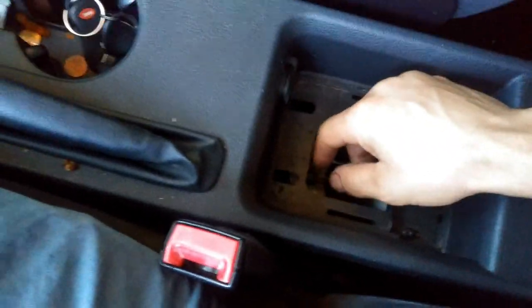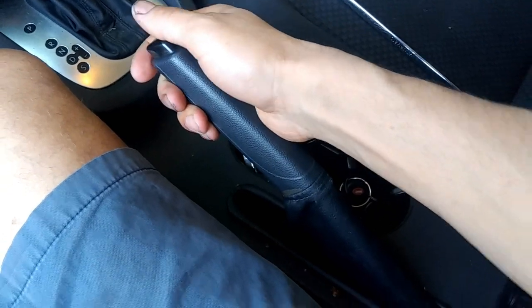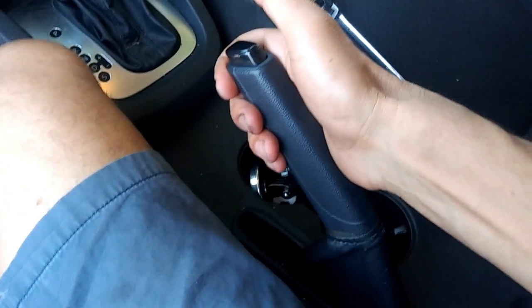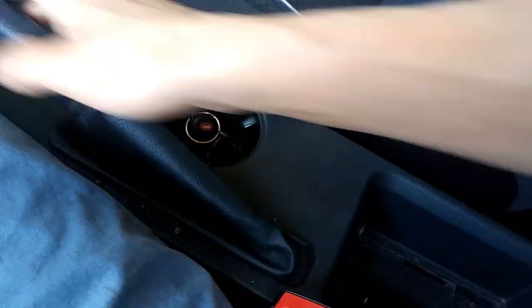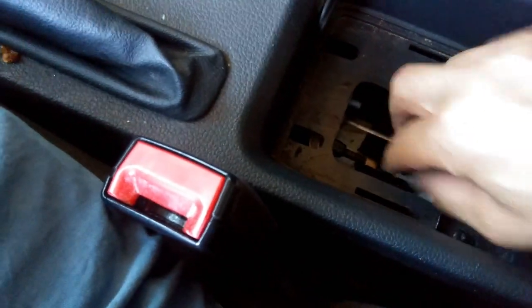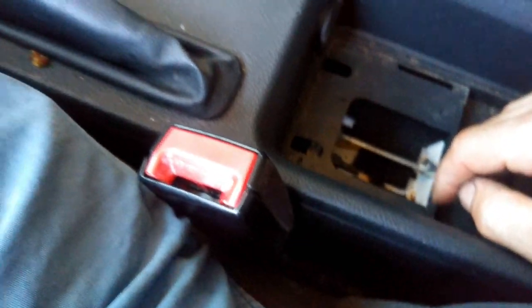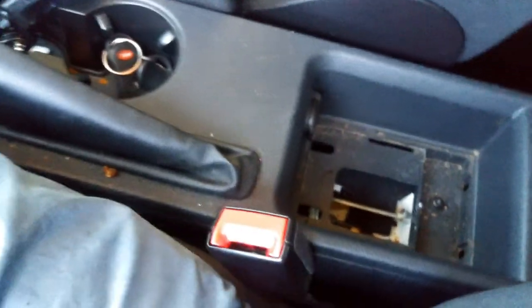The most important part is the tension of the emergency brake — this will let you get the feel for the brake. The way you're going to pull: one, two, three, four. About on the fourth one you're going to start feeling some tension. Five, six, seven, eight. Ten is where you really have to put some force into it. What I did was tighten the 10 millimeter bolt until it started getting snug, but it still has some play — it's not crazy tight. Some people say do it at three clicks, others say four — it depends on how this style of brake feels.